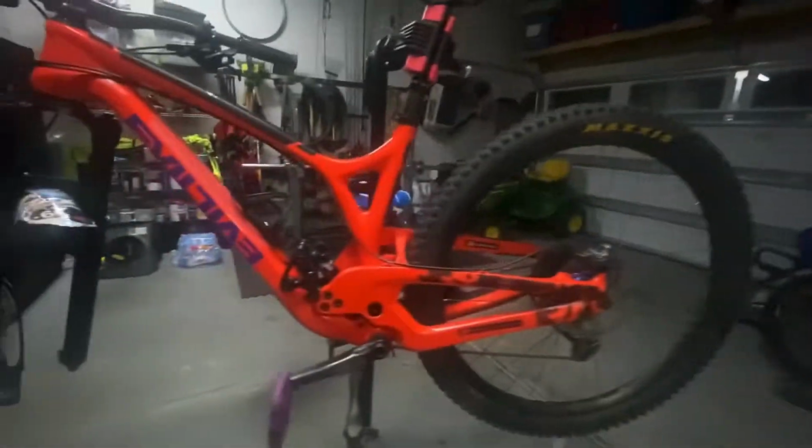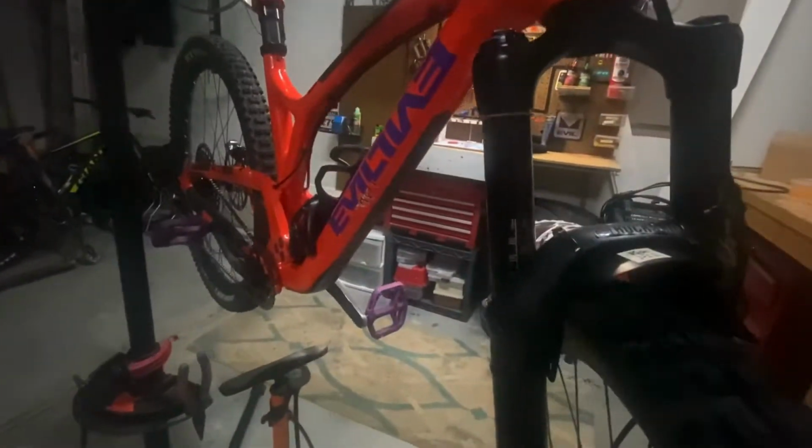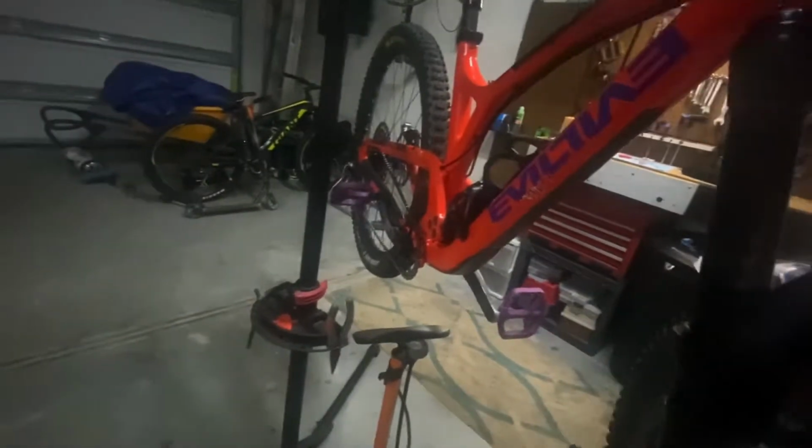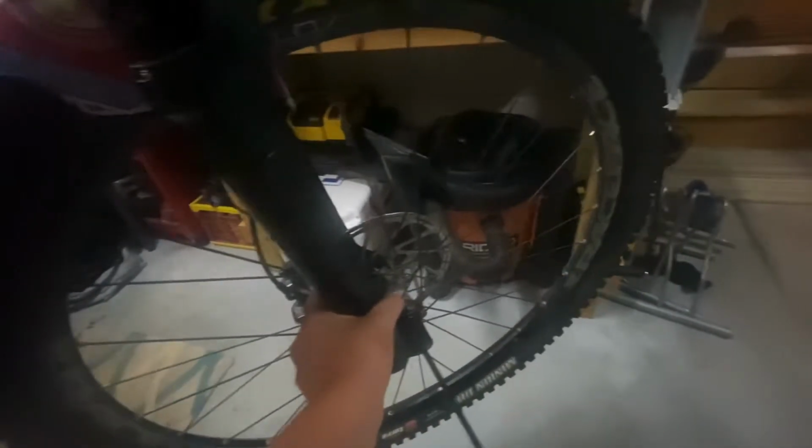And then from there, we're gonna grab our front wheel and slide that mamma jamma right back on. Grab your axle. If I can get it in the camera, right there. Okay. Slide that back on. Grab however you tighten it. If it's hand tight, then you can do that. Most of the time it'll be a 6mm Allen key. And that's gonna be your wheel back on.